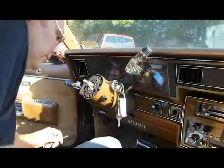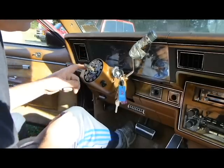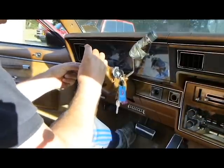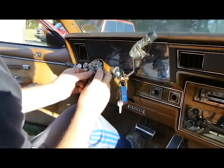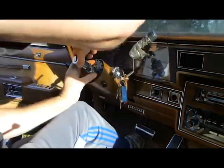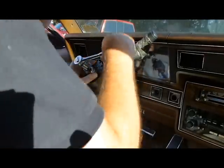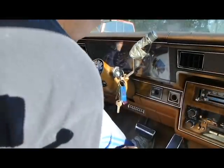Okay. Will I be able to get it? Probably not. Okay, now I need to push that down. Now they've got tools that you can put on there and all this kind of stuff, but you may not have a tool. So I'm going to take a washer and take the nut to come off of it. I'm going to put it on here. I will grab a second socket. Then I will tighten that back up. Come on, Reggie. We'll just have it hold both sides, since it wants to be a pain in the old gluteus.